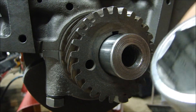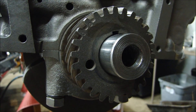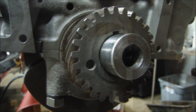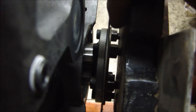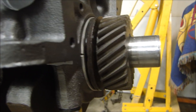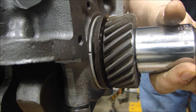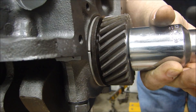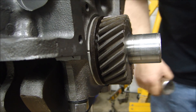Now there are a few ways you could do this, but you want to do it gently. You can take a big socket and gently tap until you get it all the way back. But what you want to do is go in the back and support the crankshaft from the back — that way you're not pushing the crankshaft back as you do this. You want to make sure the crankshaft is all the way forward and gently tap the gear on until it's all the way towards the back. I've got a big piece of metal and a shim in there against the crankshaft so it doesn't move backwards. You'll hear the sound change when it's on there all the way.